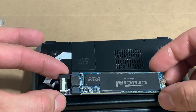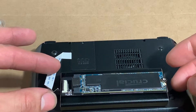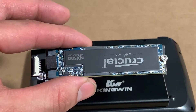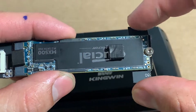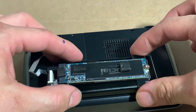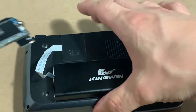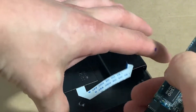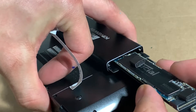You need a 2280 enclosure to put your SSD in. Make sure you buy one with space that would fit the SSD with the adapter, and make sure it's good hard material just in case you drop your GPD. This one that I bought — I need to add some spacer up and down of the SSD, and since the enclosure is wider I add some extra material so it doesn't move inside. The enclosure is stuck to the GPD with black 3M double-sided tape — this black one is stronger, it won't come out so easy.